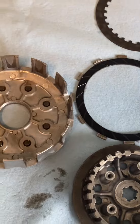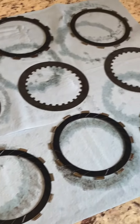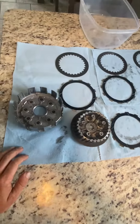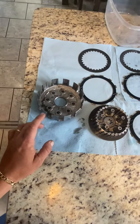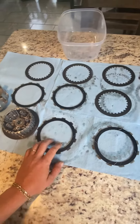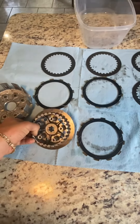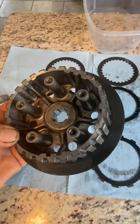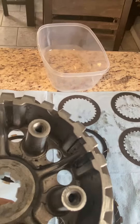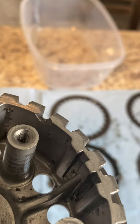That's what you look for when checking a dirt bike clutch — whenever you're having problems like slippage or anything like that, this is what you look for. In this case I will buy a whole new clutch basket, inner clutch hub, and plates and redo the whole assembly. The reason I'm really moving forward on the inner clutch hub is because there is a chip right there and I just don't like that, so I'm going to replace it.